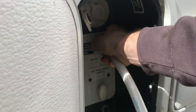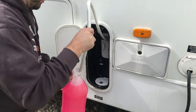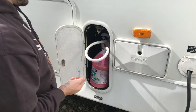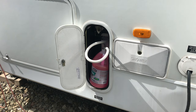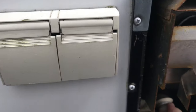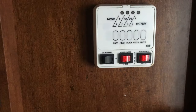Connect this line. What I've found is if you do this just right, you can get the hose down in the bottle and put the bottle inside this little doorway, so no one has to be out here holding it. The hose isn't quite long enough to reach the ground, but this works well because now I can go around to the different faucets, run them until the pink water comes through. It'll take more than one gallon for this camper. The hot water tank is done draining, so I'm going to put this cap back in, just finger tighten it for now — I'll tighten it back up in the spring. Close this door, and then pump the pink water through. I need to turn the water pump on.